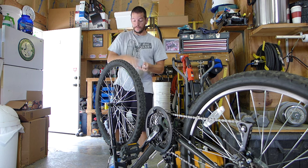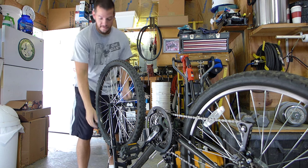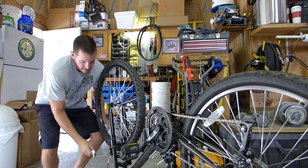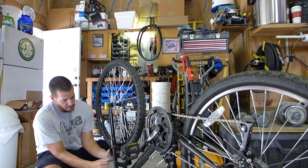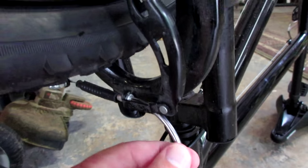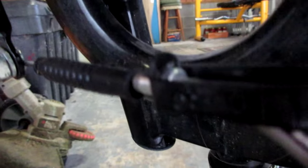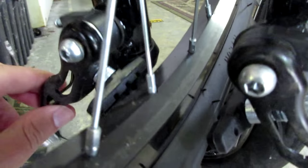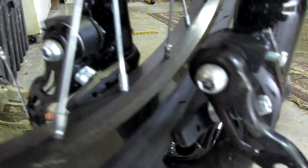The first thing we're going to do is — since it's got the caliper brake up here by the rim — you need to loosen that. It's real easy: squeeze your brake lever together and pull your cable out. Squeeze this part together to get this cable out; there's a slot right here. Squeeze with one hand and pull the cable out with the other, just like that. So then it just relaxes free, which frees up the brake pads from the rim so that you can pull the wheel off.